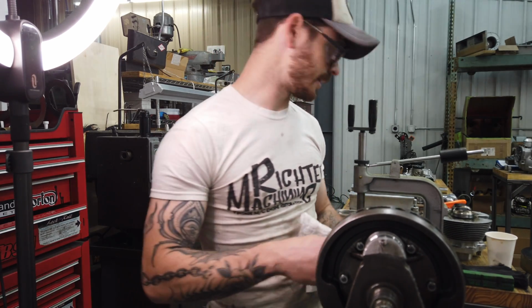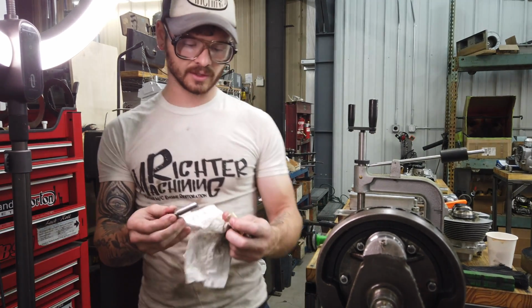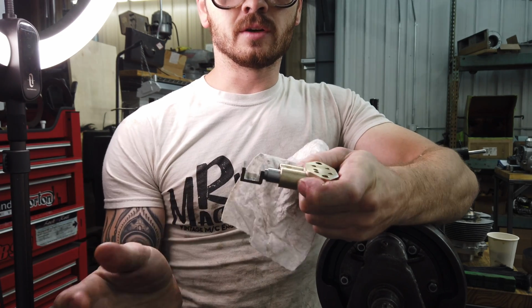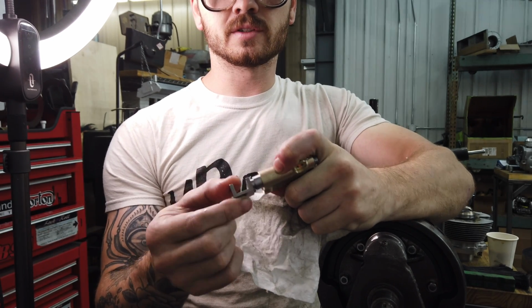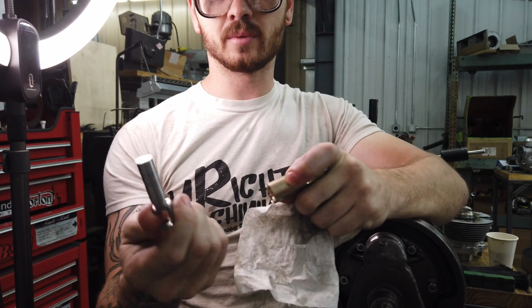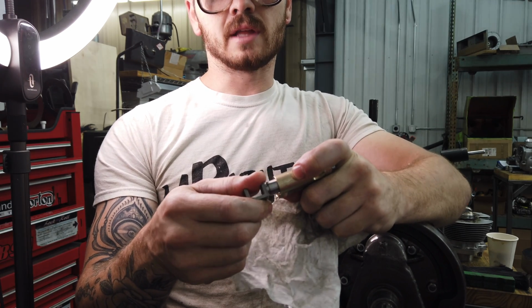and I think this was the big thing for his original pump. I'll try and get a hold of it so I can show you, but put just a single plunger in and then feel if there's any play. If it walks back and forth, all of your pressure is going to escape around that piston, or plunger, whatever you want to call it. So that's the most important.